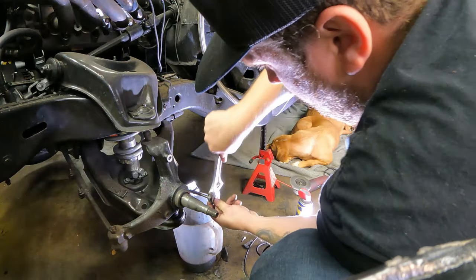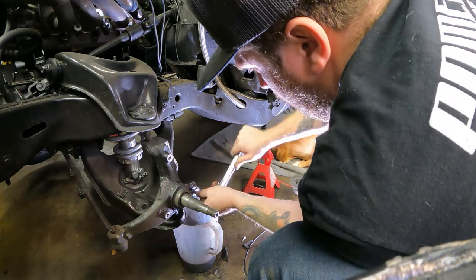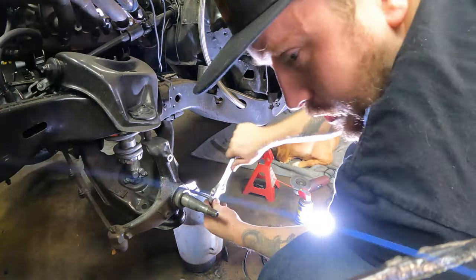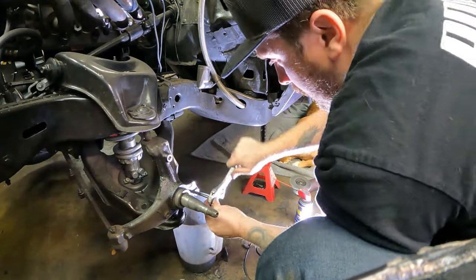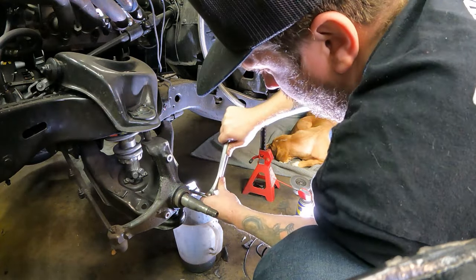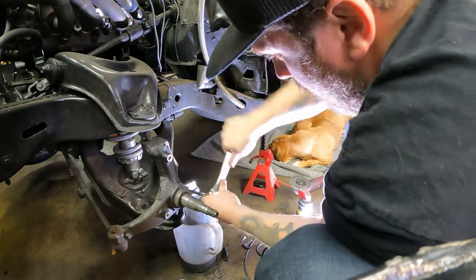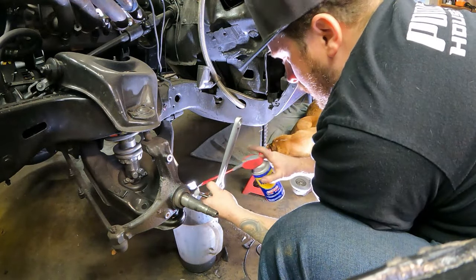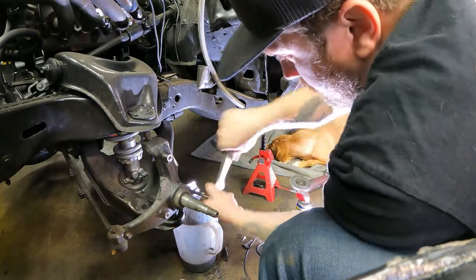So, just go ahead and tap this all the way through. And I'm breaking out the back right now. You got to be careful when you're breaking out the back on a through hole. It'll want to tighten up. It can be easy to break your tap. You don't want to do that. One thing that you don't want to do is break your tap in your hole.